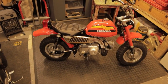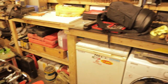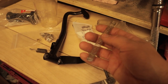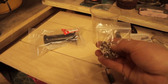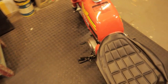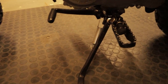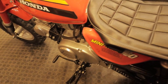Quick update — it is Boxing Day and I thought I'd get in the workshop and spend the day getting this thing together. We've had a good tidy up and this is what's left to fit: brake lever, brake connection point, some fuel, guards, braids, brake spring, right-hand grip, and finally the seat cover. I've also been working on the kickstand — I bought a kickstand that's not for this model, it's for the K2, but we've made it fit because these things are impossible to get. I've turned down a lock nut so it's smaller and clears, and now we've got a nice solid kickstand with the correct spring — so it is now safe and stands on its own.